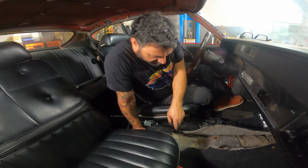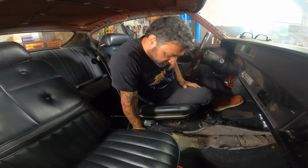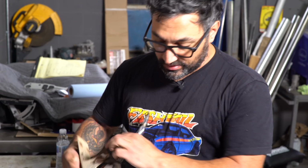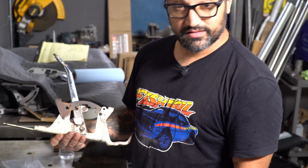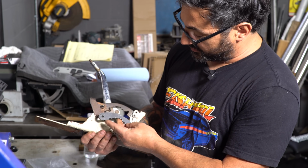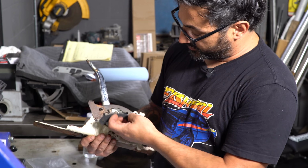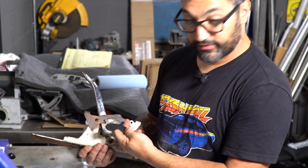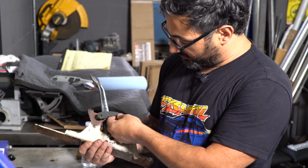It's okay. This is like, was the drive shaft banging into the floor? I don't really know. We will figure it out. So the central piece of this system is this detent bar here, which has just an extra space for the overdrive. This has, you know, 1, 2, 3. This has 1, 2, 3, 4. So that's the secret behind the way this thing works.